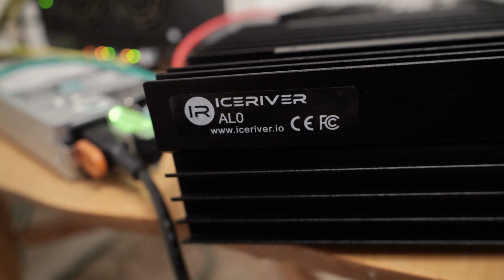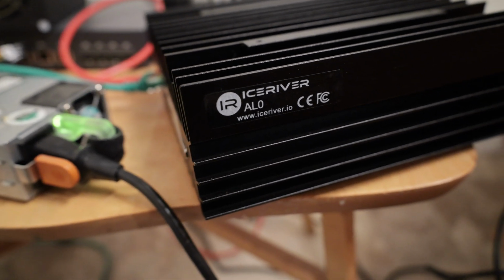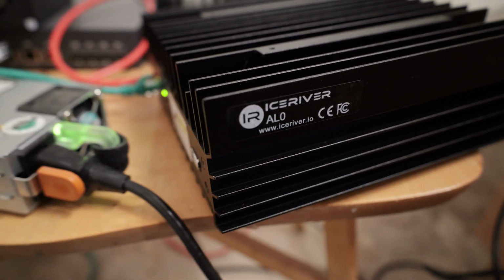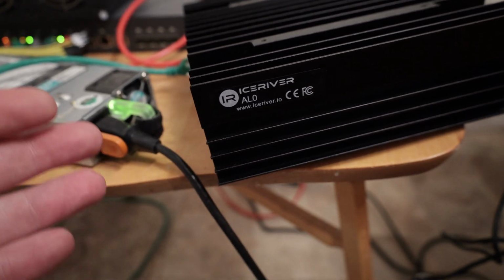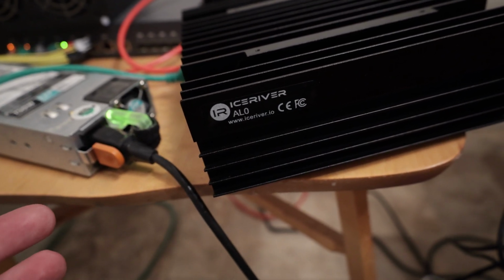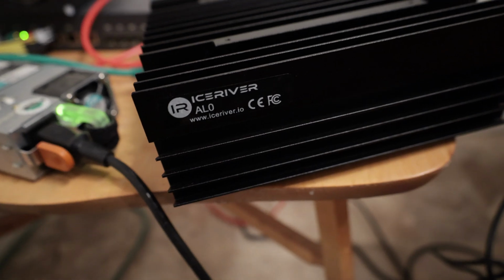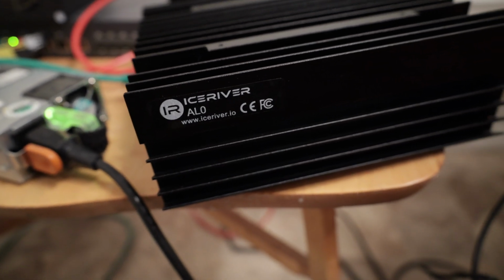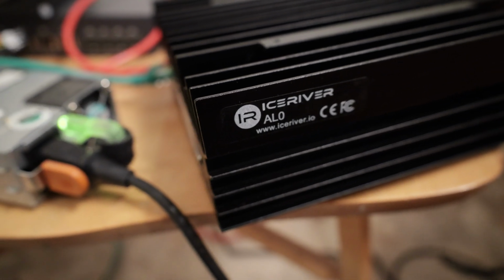All right, guys, so that pretty much does wrap up this video. We went through everything you need to know about Iceriver's new Alephium ASIC, the AL0. It has a different setup process, which was pretty nice, actually. You need all 3 pools in there, or it will not run. It'll give you an error. It's nice that they actually added the name into the router so you can see what it is by default. Also, the dashboard actually works, unlike the new KS0 Ultra.